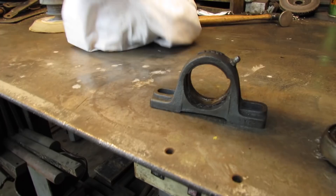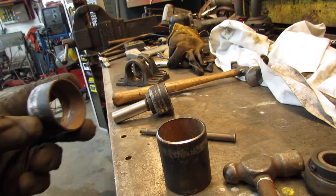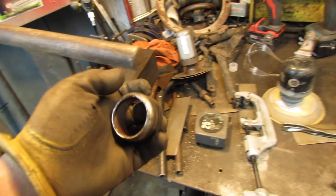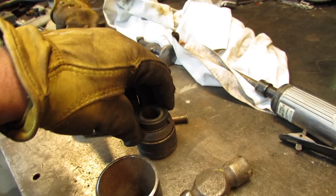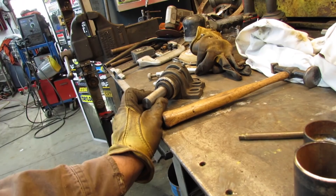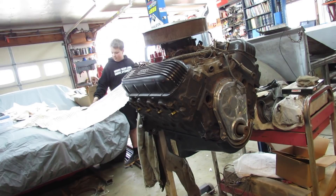Let me show you what I'm doing. I found a piece of pipe — I ain't really sure what that's from, I think it's maybe from the steering column off that '46 when I shortened it up, so that's appropriate. Using this little thing I put in my vise, I rolled the edges over like that. See, the top of that bearing is a little round, and then that will fit in there and come up against it like that. So I'm gonna have the same thing, only different and less ugly — that's my plan.